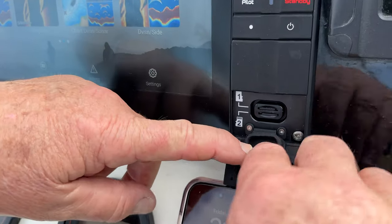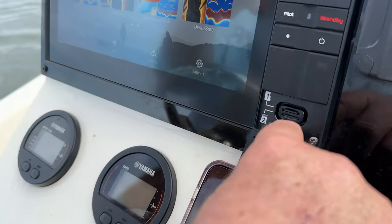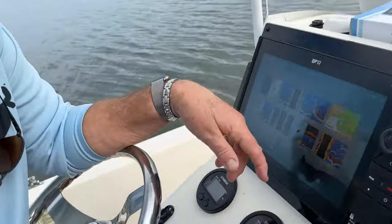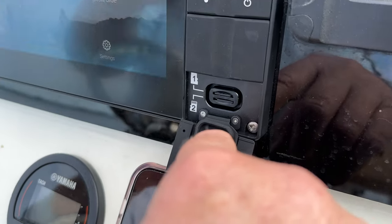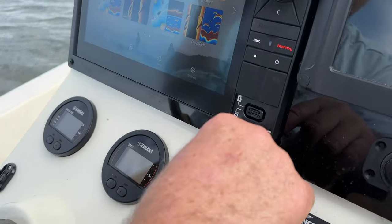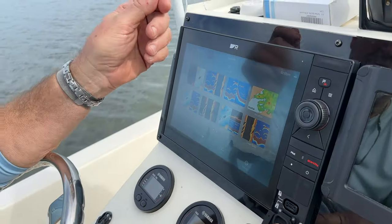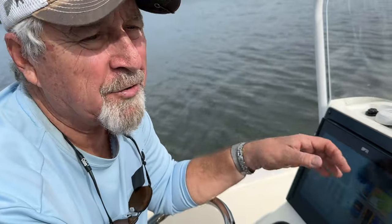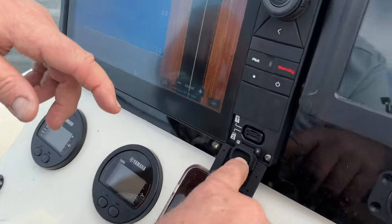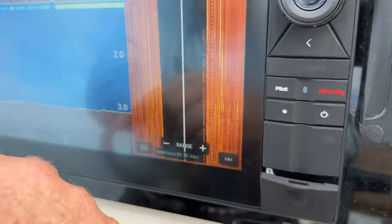Now, on this machine we have a dual card slot — the upper slot being number one and the bottom slot number two — and on the back of this unit I have an external card reader called the external slot. On the slots, you have to make sure that you do not save your waypoints to the card that has your maps — this is a big deal. Because if your map card happens to be full or close to full with map data and you start piling on external data like waypoints, it'll start erasing your maps. So you take a blank card, put it in the extra slot, and once it's inserted, go into your menu screen or home screen.